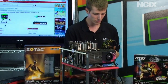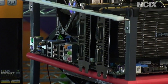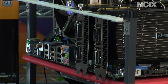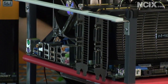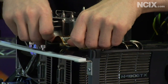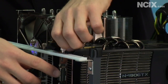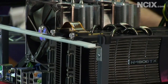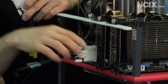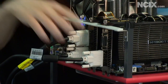It's the same thing on the GTX 400 series — you've got your two DVI ports and then one mini HDMI port. You can only connect two displays, whether they're HDMI or DVI, to each graphics card. That's why NVIDIA came up with this solution. I'm now finished installing my MSI GeForce GTX 480, and I'm going to install my SLI bridge, which you will need. NVIDIA came up with a software solution to allow you to connect two monitors to one card and one monitor to the second card. That is why NVIDIA Surround requires two cards, but for many people it's better than buying an active DVI to DisplayPort adapter — which runs over $100 — or buying an expensive DisplayPort monitor. That is how you hook it up: two monitors to the top card and one to the bottom card.